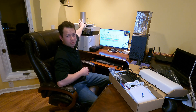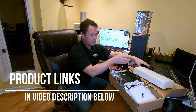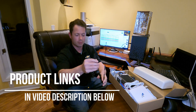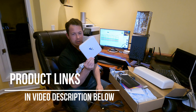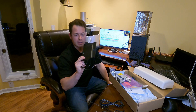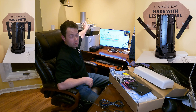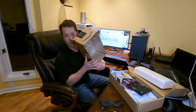Hey everyone, this is Nate and this is the Nader Tater channel. Today I'm going to talk about my T-Mobile home internet gateway and installing external antennas to it. Here's one of the panel antennas, some little mast antennas — they're separate so we combine them together for a 2x2 MIMO. Then we have this other cheap one labeled 4G LTE, and here's a Netgear antenna designed for hotspots. I also messed with the internal antennas, rearranging them on the device — and lastly there's the aluminum foil box trick.